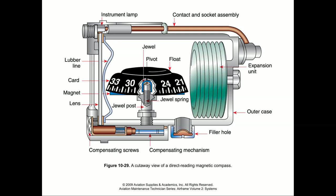Next we're going to start talking about directional indicating instruments. The most basic form is a magnetic compass. This diagram is similar to what we commonly call a whiskey compass, partially because the entire cavity is filled with a thick, almost kerosene-like liquid that helps to damp the rotation of the card — this indicating portion. Each hash on the card is five degrees, and when the pilot looks at it, it's lined up with what we call a lubber line, which is just a bar in front of the window where the magnetic card shows the actual heading.